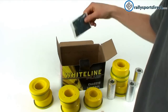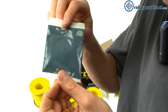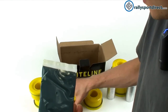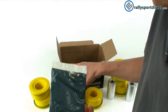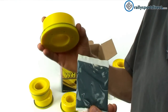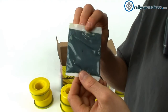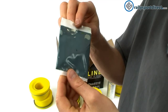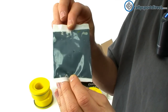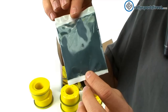With any polyurethane part that you put on your car, please remember to grease them up thoroughly. Polyurethane loves grease — it hates dirt, it hates dry conditions. If you keep them properly lubricated, these should last you the life of the car. It's when people fail to grease them and fail to clean them that they start failing, making noises, squeaking — that kind of stuff. You really shouldn't have a problem at all, as long as you perform some basic maintenance, keep them clean and lubricated.